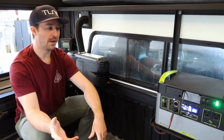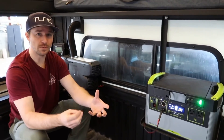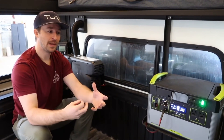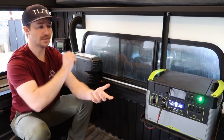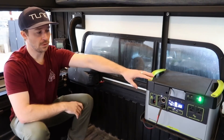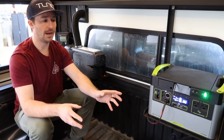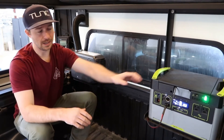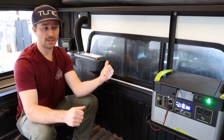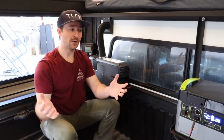The last critical component of the heater system is going to be your power source. Although propane is coming into the Truma heater and combusting to create heat, it's required that there's electricity to power the fan to force air over that heat exchanger, and obviously to power the thermostat. We use Goal Zero batteries — we've used them for a long time and they've got good simple interfaces, but there are a lot of options on the market, from DIY setups using things like Redarc to other competitors that can also power your Truma heater. Whatever power option you use, that's a critical component — but that's basically it for the entire heater package.